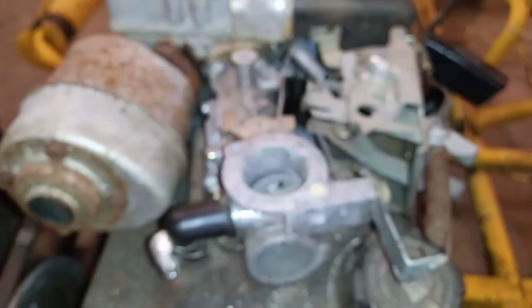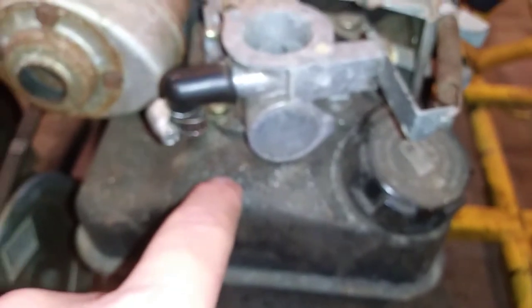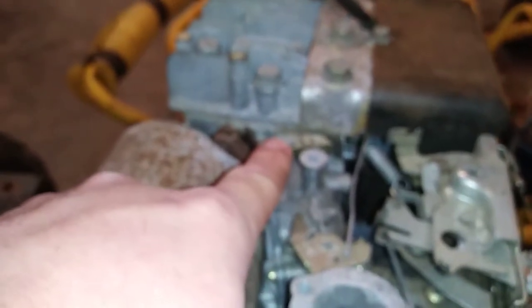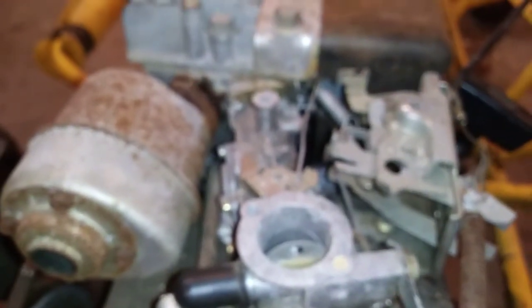The next step is going to be a multi-part process. I'm going to go ahead and remove the carburetor because it's going to need to be cleaned up anyway — it's been sitting forever. The tank still has some fluid in it that I'm sure is nasty. I'll dump that and clean out the carburetor. I want to see if I can get some WD-40 on that valve stem to hopefully loosen it up. If not, I'll probably have to pull the head off and give that valve a few taps. We'll take it a step at a time — first thing is remove the carburetor and tank.